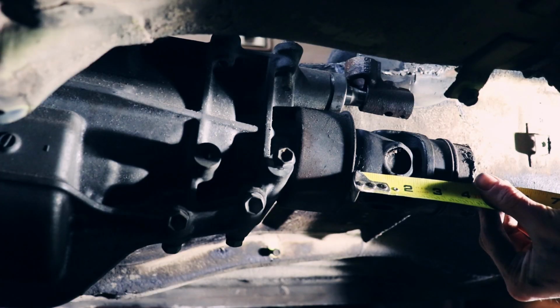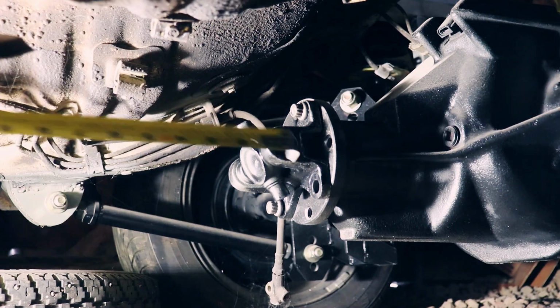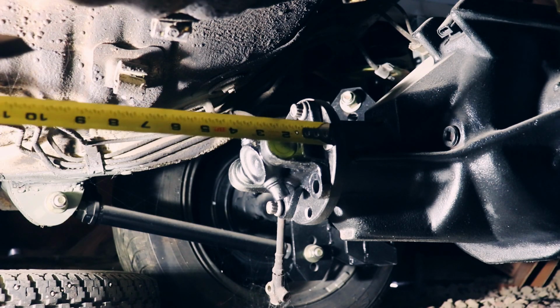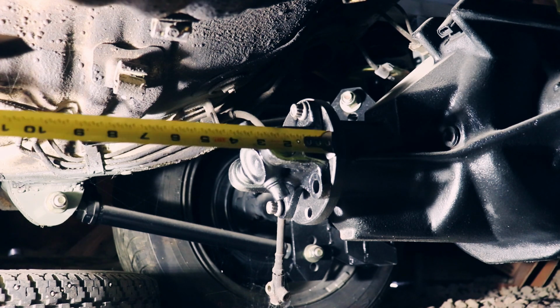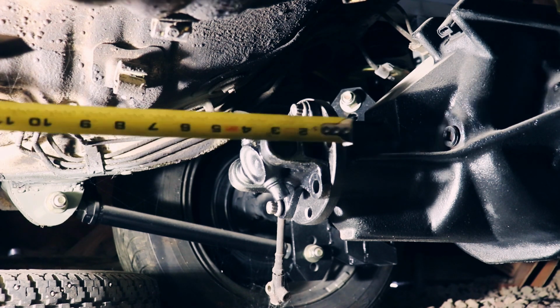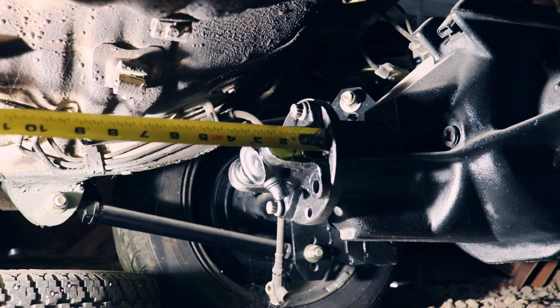So that looks pretty money on 1 5/8". 1 5/8 is my base point with my 7/8 inches of clearance added in. You definitely don't want to rush this whole measuring process. Double check everything because drive shafts are pretty expensive. This one ran me about $300.